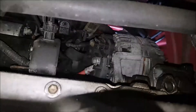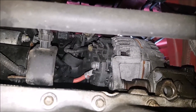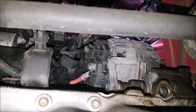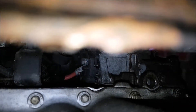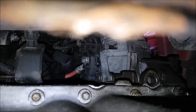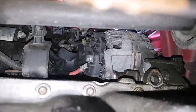The only way you can get to the Corsa D's alternator is underneath the car, and it's not too bad once you get in. You can see that bolt there with the red cable — that's going straight from the alternator to the battery. I need to do that one, then alternator to chassis or ground, and then battery to ground. That's quite simple.